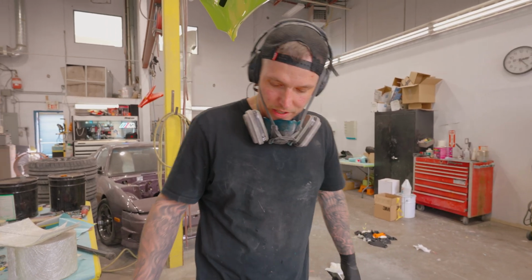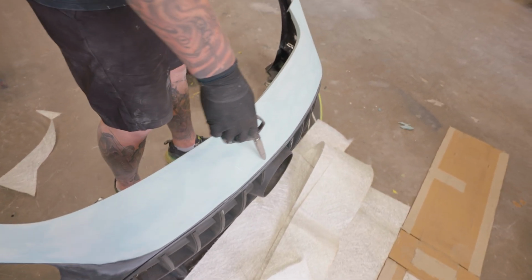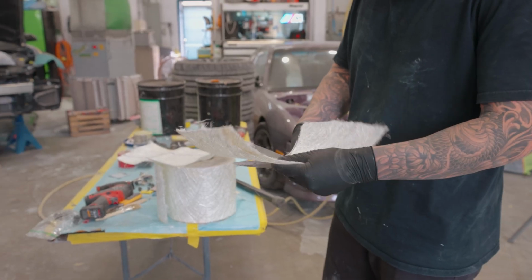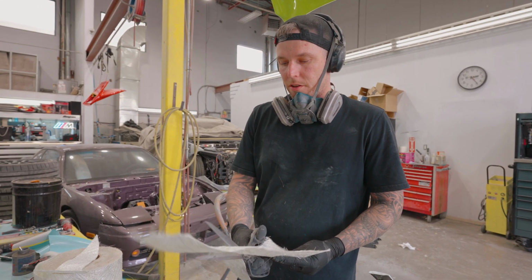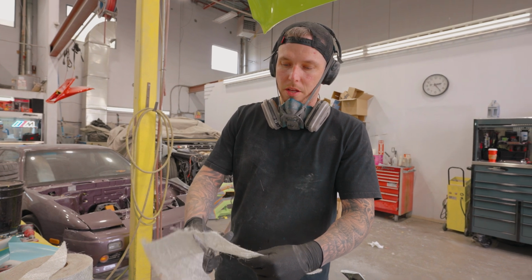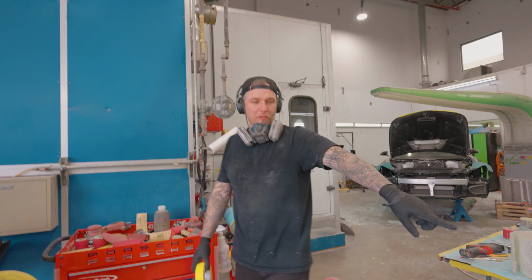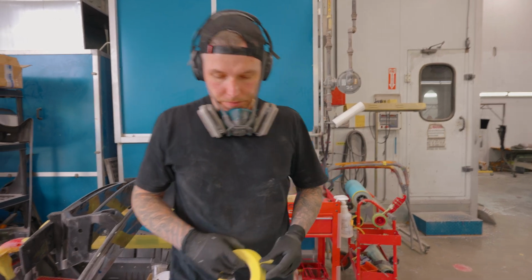And then at that point, I'm gonna have to figure out how I'm gonna attach the two, but I think it's gonna be somewhere around here with a flange. And then I'll be glassing the new piece on and then eliminating all this. It's a lot of work, man. We refined a lot of it, made all the mounting points good, so that's all sorted out. Once this is completed, then we can start the final bodywork stage and then get in some primer. Just doing the front of this bumper is probably close to 16 hours so far. Oh my gosh.